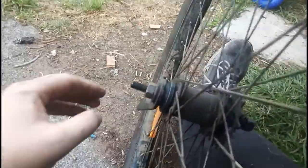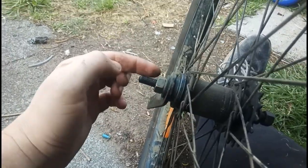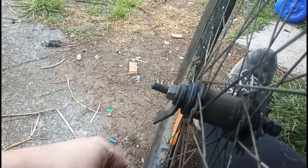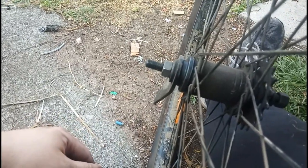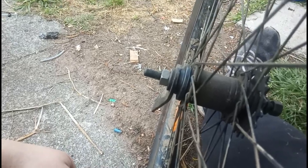We do have to remove this nut. What you want to be careful of is not rotating the coaster brake arm, because you have a chance of loosening the cup and bearings — the cone inside there — and that will muck up your wheel. That is the mistake I made with the Mark 4 bike, which is hiding in pieces with no rear wheel. So we're going to go ahead and remove this.